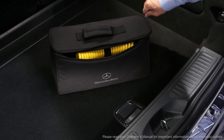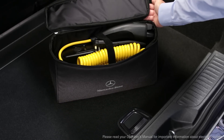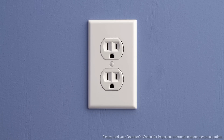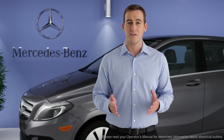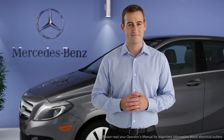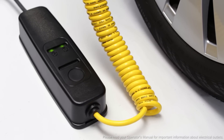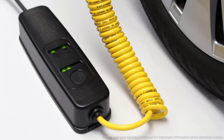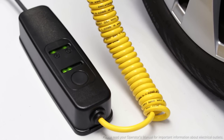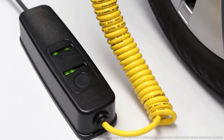Your B-Class comes with a charging cable that's specifically engineered for the car. It's stored in a case in the cargo area. You can plug it directly into a standard three-prong household outlet that delivers 120 volts. We don't recommend using an extension cord or any non-approved adapter. When you plug it in, you'll see a few LED displays. The top row is actually two readouts — a green light on the left indicates it's receiving AC current, and a green light on the right confirms the built-in circuit protection is active. It might take a moment for these to appear after a self-test.